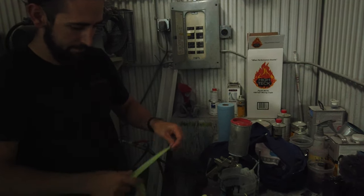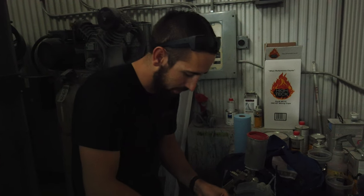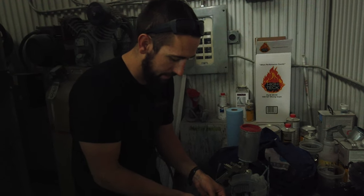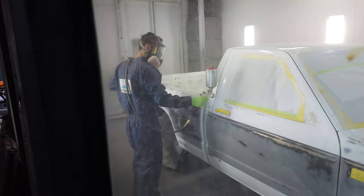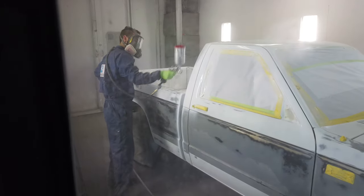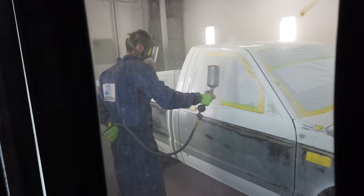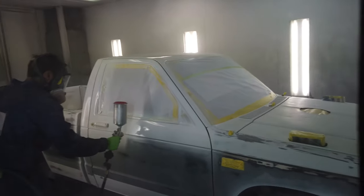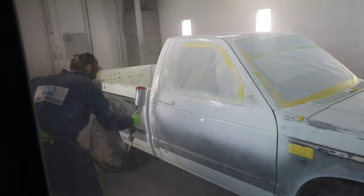That's why I wasn't too worried about any sort of color — just keep it simple. Don't paint door jambs, don't have to mess with stuff. Keep metallic out of it too, because metallics show dents — the metallics lay weird and kind of build up in those areas. Old Bernie's about to get a fresh coat of paint! Coat number one going on — see it going gray... nice bright white. Started working the top, working his way down. It's going to look so good. Kind of sucks when you look at the hood and see those hail marks, but that's what the truck is intended for — pretty simple. This is going to help out a huge amount.